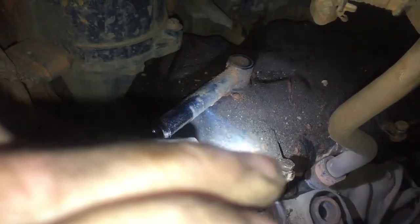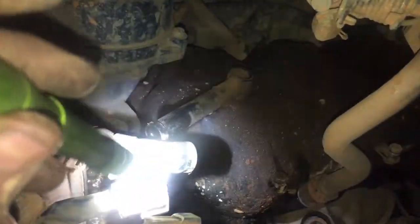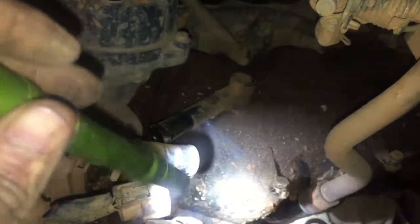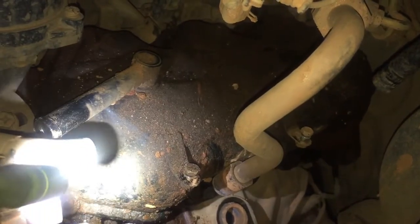Well, you got 1, 2, 3, 4, 5, 6. I want to say 7. I think 8 screws. They're all number 2 Phillips. Why? I don't know. It's pointless. You always strip the heads on these every time. Good news is you can go to the hardware store and get replacement bolts with hexes, but yeah, you can strip the threads out way easier because it's an aluminum block.